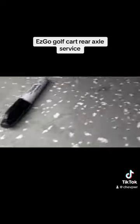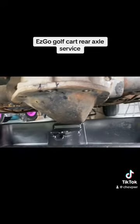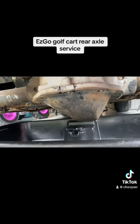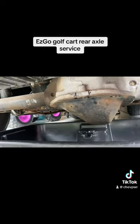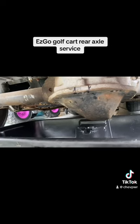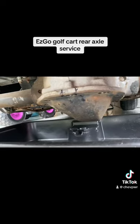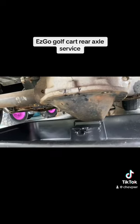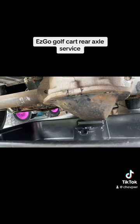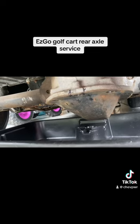At this point I got everything out. Now I'm going to get a flat blade and work this cover off the axle. The key is I did put a mark — you don't have to, but I always like to mark at least the starting point or the proper position. And just when you're working your way around the cover, these are not very rigid, so don't try to mangle it or bend it or even crack it. It should come off pretty easy. We'll see — I don't know how long it's been since it's been serviced.